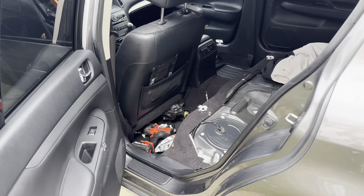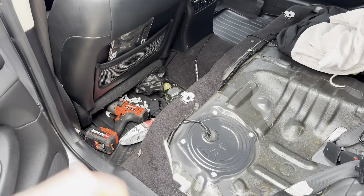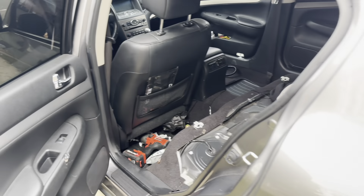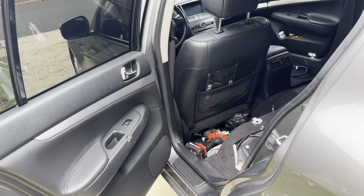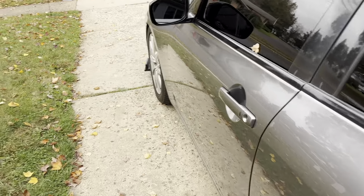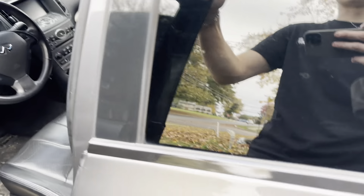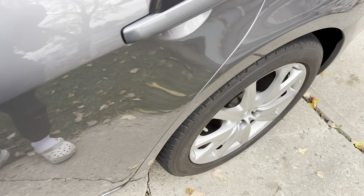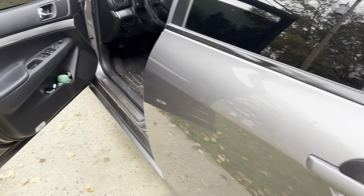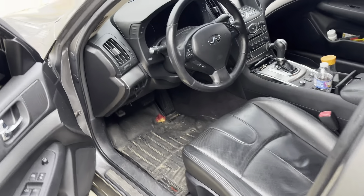It's a really simple install — like building Lego. Just unplug something, unscrew a couple of screws, screw them back on, and plug it back in. If you had a P0462 code pop up on your OBD or DTC scanner — which should say 'fuel level sensor circuit one low' — this is the fix. The sensor itself is around $120, but now you won't have the issue of running out of gas when your fuel gauge says you're full.